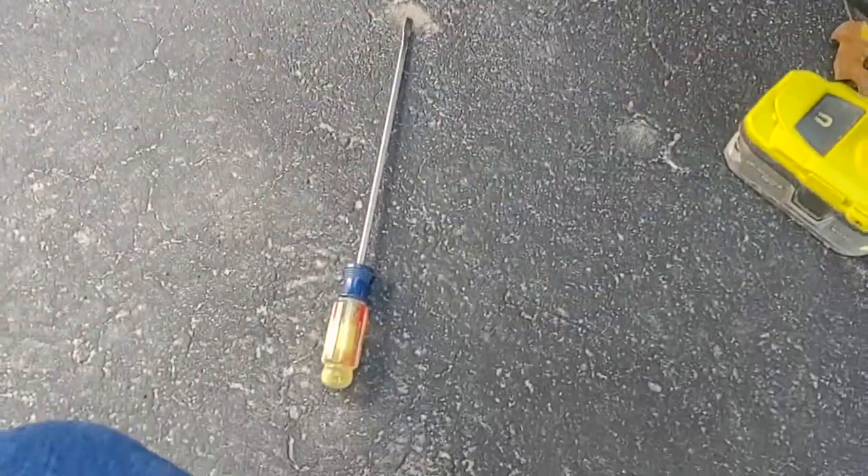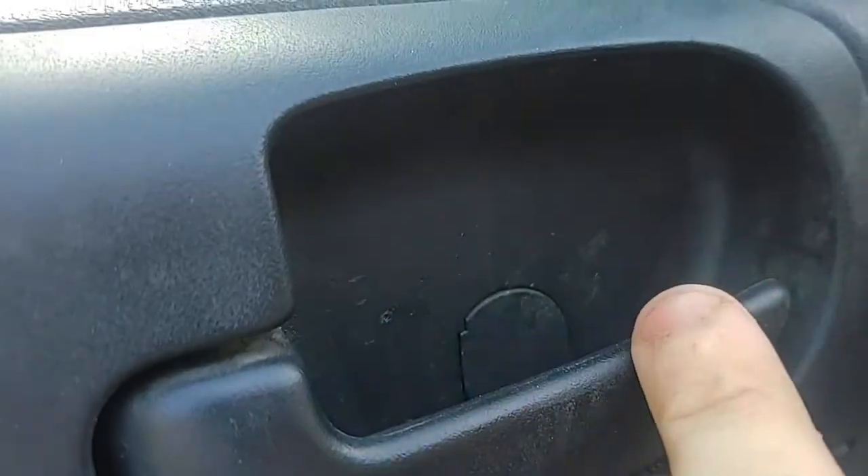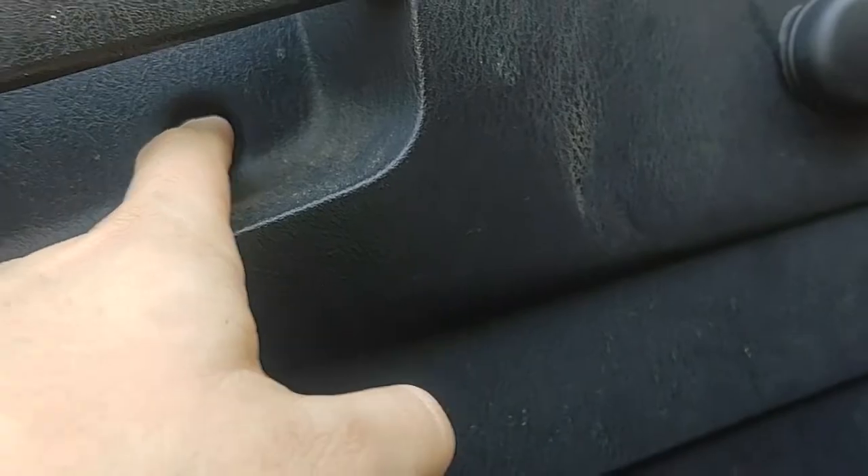Let's get on to the next clip. For replacing the mirror or doing the speakers, you're going to need a screwdriver, screw gun, and a rag — a rag to take off the clip behind here for the roll-up windows, and a screwdriver to pop off the clip to take the door out. That's a Phillips. Then you have a Phillips screw here, another Phillips screw here, and one more up in the corner.